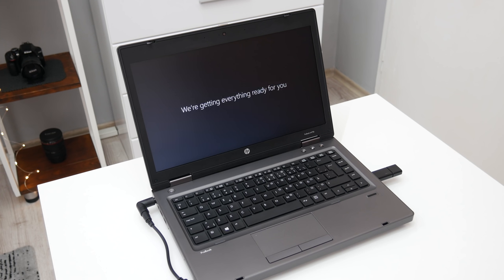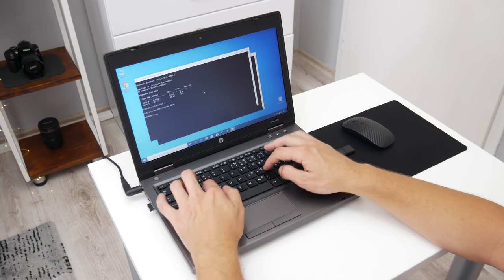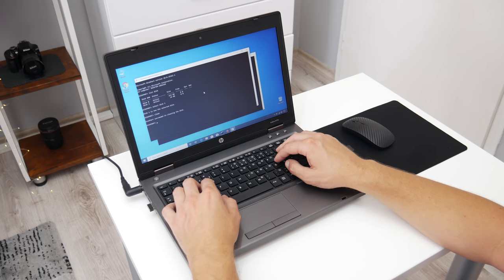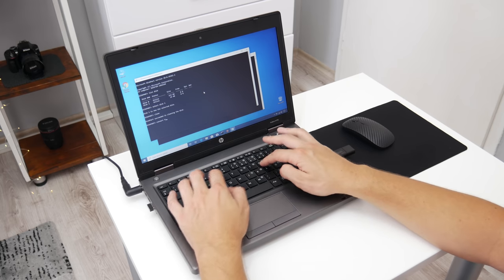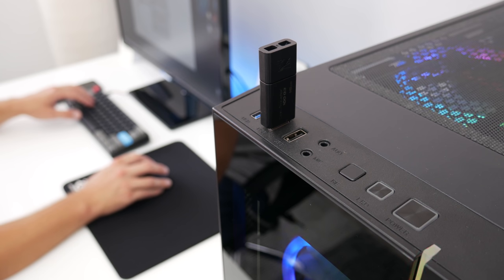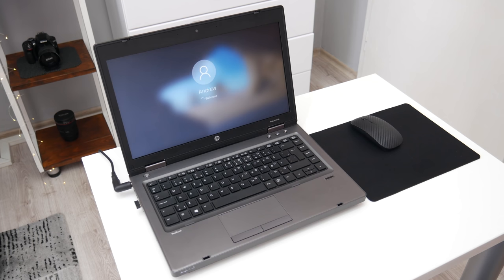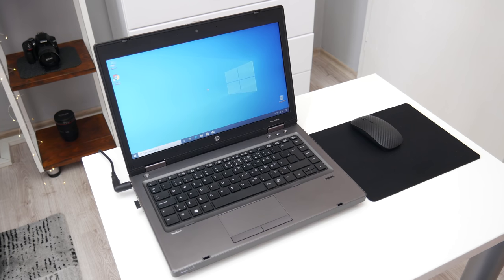So, to fix this issue, first I contacted the support, and from there, they gave me instructions on how to reprogram the DMI. Basically, this is not hard at all. I created a boot USB with MS-DOS and a few other tools, and after using this USB, I got access to the motherboard's system files. And there, I entered the serial number and all other information manually. After this, the message that appears before the boot is gone, and the laptop is booting straight to Windows. After, in Windows, I made online activation and Windows was successfully activated.